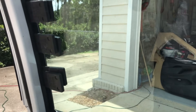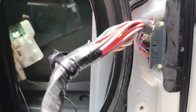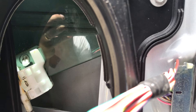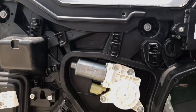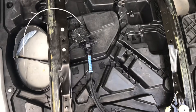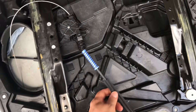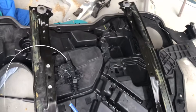If you're doing this solo like me, you'll need to lower the window just a couple more inches and rebrace it. Down where you took the speaker out is where you'll find the other side — stick the flathead screwdriver through there, release it, and you'll have a free window. Then lift it all the way back up and prop it in place so you can remove the whole black contraption to put the new regulator in. Here is the back of the black molded plastic attachment — and this is what's left of my window regulator after it exploded.